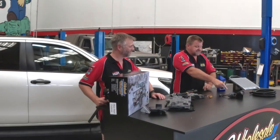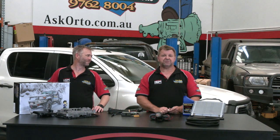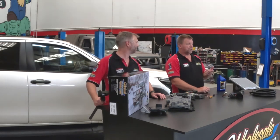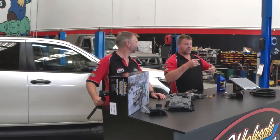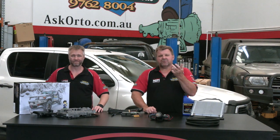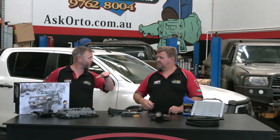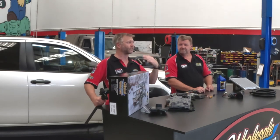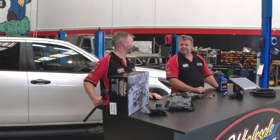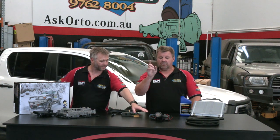The last item is the temp gauge kit. People think it just tells you the temperature — but what it actually does is teach you what the car does and doesn't like. By watching the temp gauge over time, you'll quickly learn what she doesn't like. You'll actually be able to predict things like: 'I reckon she's going to get this hot going up this hill, towing this vehicle on this hot day.' When something's not right, you'll see it and pick it straight away. What people don't realise is that transmission temperature doesn't just climb to a certain level and stay there — as you travel up a steep hill, the torque converter is taking up the slip and generating heat. The temperature can go from 60 to 90 degrees in less than three minutes, and when your lockup comes in, you'll notice the temperature suddenly drop off.